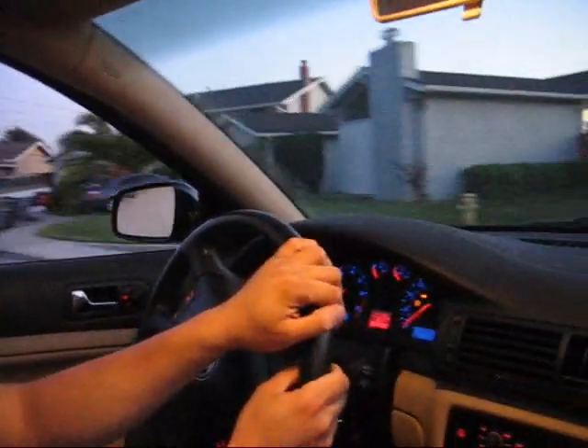So I have sensorless vector mode working, and that allows me to control torque and speed, where my previous inverter only let me control speed. So my throttle pedal now controls motor torque, so I step on the gas pedal, it drives like a normal car. And I can get up some speed, let off the throttle, the motor will just coast — that lets me shift into second gear, and instead of coasting I can also do regenerative braking.